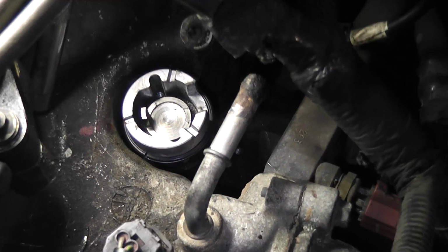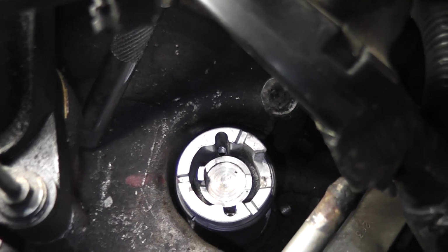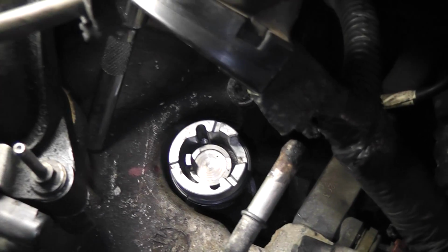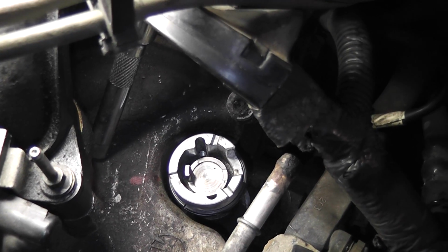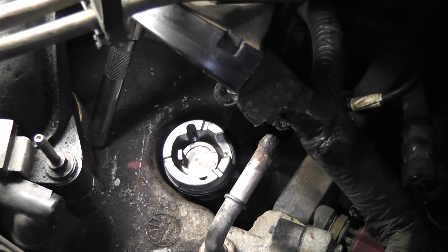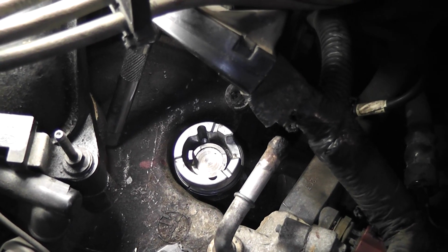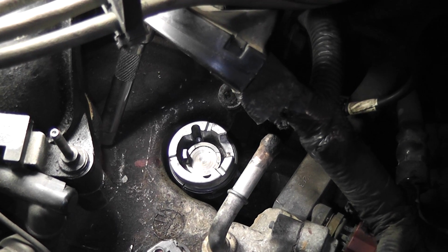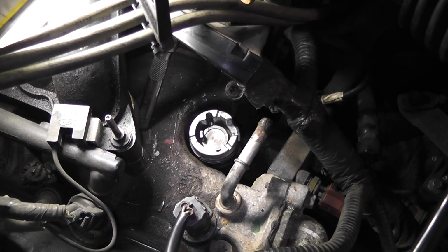In all honesty, I was going to edit all this out and do it right the first time, but this is a shop and it's an old car and this kind of stuff happens. That's one of the reasons I like painting things and marking what I'm doing, especially with timing belts, because I can't find the mark on the pulley for #1 top dead center. The only thing Mitchell is showing is the timing gears with dots on the chain. And Nick here in the shop Googled it and everybody's complaining about where to find them.